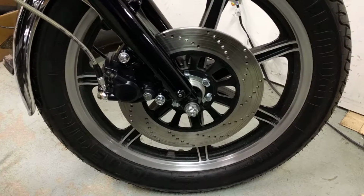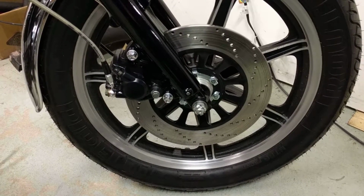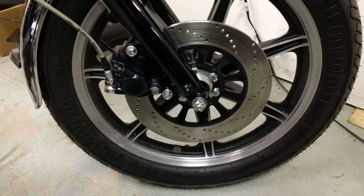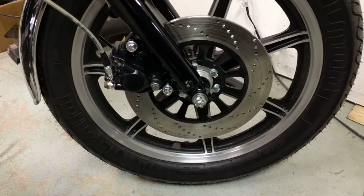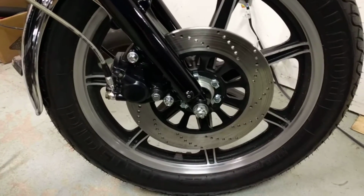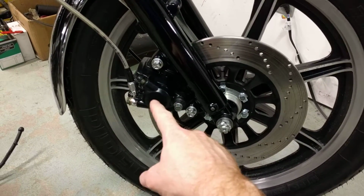All right. Seems to be some controversy out online. I've looked on a lot of blog sites about drilling out your rotors and why. I'm going to keep this pertaining to any of your early vintage, the late 70s, any bike with solid rotors. The material back then had a tendency with the heat buildup to gall on the pads, and I wish I had saved the old pads that came off this bike.